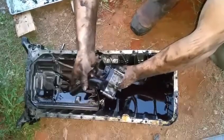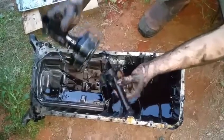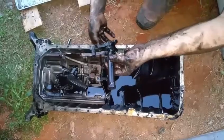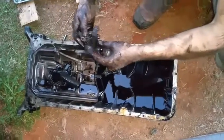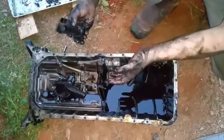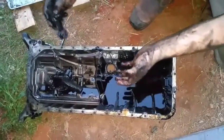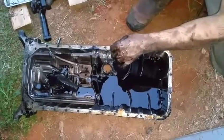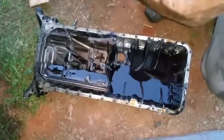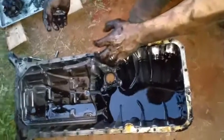Once the transmission is loose, it's going to be hard to get the oil pan out because everything else — including the steering column — will be in the way. This concludes the video. This is a difficult way to do it; I don't recommend it. I think the better approach is to remove the engine completely along with the transmission and do it that way, because this method makes the job a lot harder. Thanks for watching, hope to see you next time.